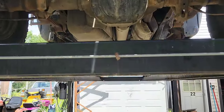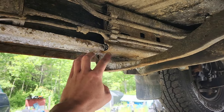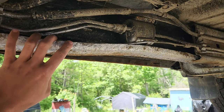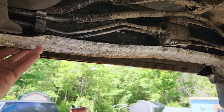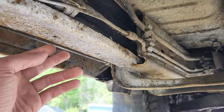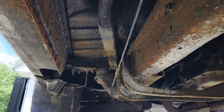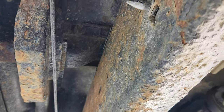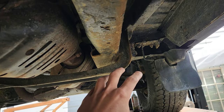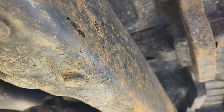Now there is a spot that had to be slightly repainted, and I actually covered this in the video. I noted that the rust converter along this area, when I went to spray it, was not quite dried off entirely, and I should have given it more time. That ended up being absolutely correct. I went back later and spray painted it with this horrifying silver because I wanted to mark the area. On the outside, you can see that from the splash from the front tire coming up through, it ate into that section there, which is normal, and then you can see where the splash zone backs off. Over here on the other side, we should find the same exact thing — right from the tire you have your splash zone, it'll come back through, and then back here where it's not getting impacted, the Rust-Oleum is still perfectly fine.